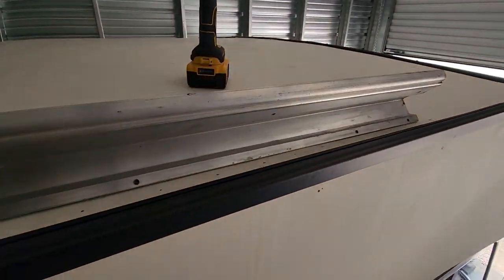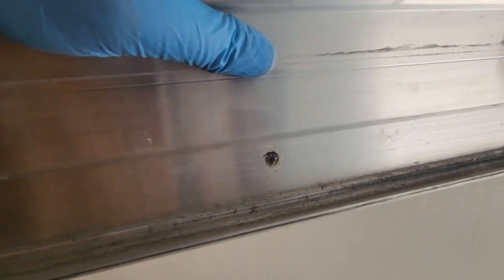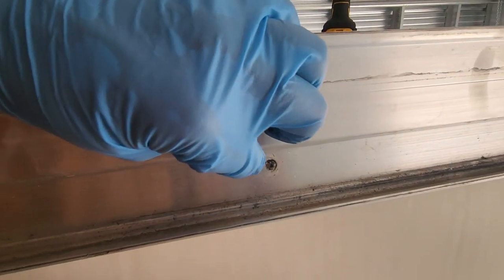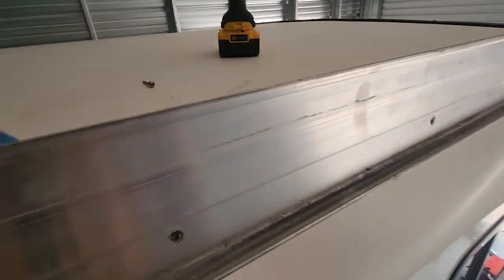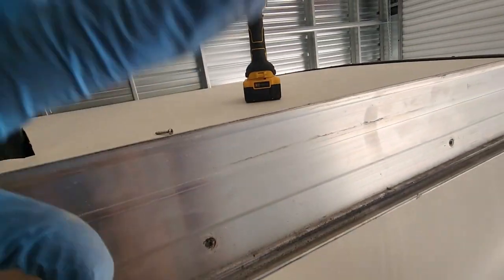and then with this awning mostly in place, pretty close to lined up, put it in place, you press down and really get it down to where it's going to be, and I was able to visually see the dots behind several of these holes, so I knew I had it in the right spot, and so I screwed it in the right spot with one screw. And then up here I made a dotted line with my Sharpie all the way down the length of the awning mount base.